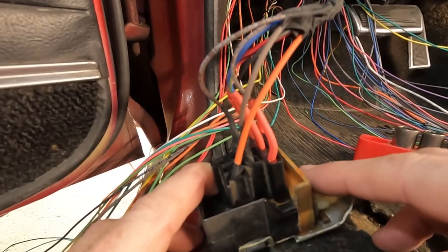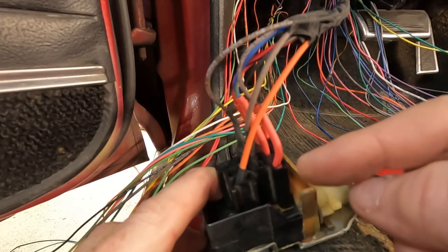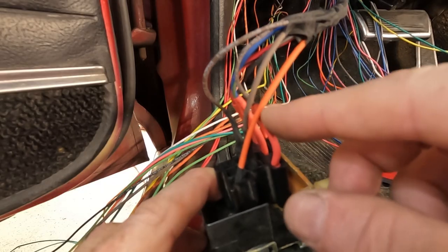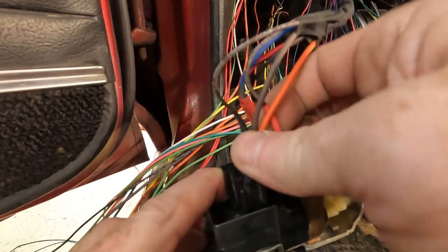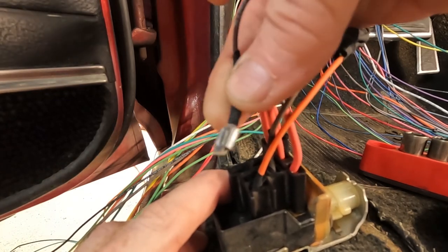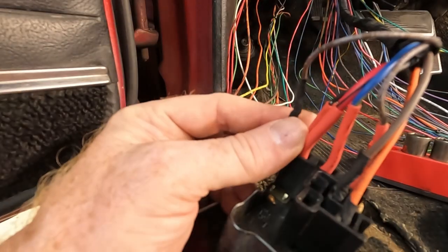If a light like the dome light doesn't work, for example, I can figure out maybe I've got it plugged into the wrong one. I'm going to plug this in, tape this up, and get that back up in there and out of the way. Here's a quick tip: don't tape up so much that you can't read the wire numbers — I actually had to take tape back off just so I could see the numbers. Do not tape up until you've got everything plugged in correctly. Also be aware that when you're putting terminal connectors down in there, the prongs sticking up can sometimes push the wire back out. So hopefully you've got it in far enough that it clips and hooks on. This one came up on me — I think my little tab got bent back. So check every wire and make sure it's not coming back up.